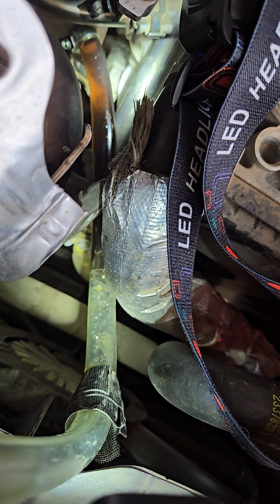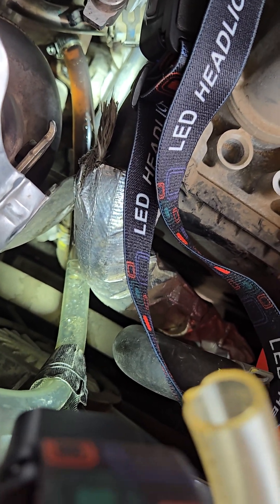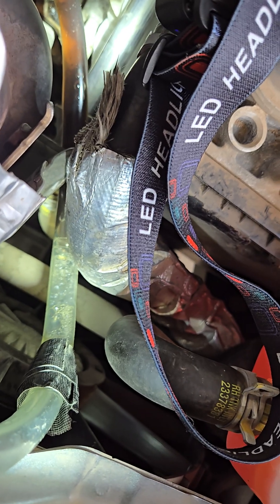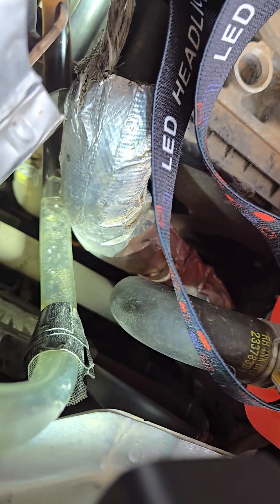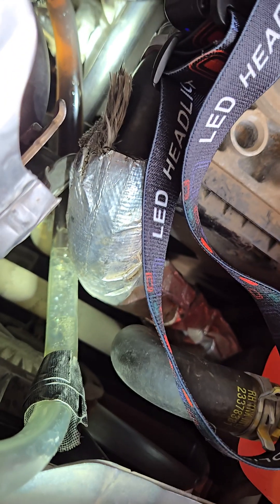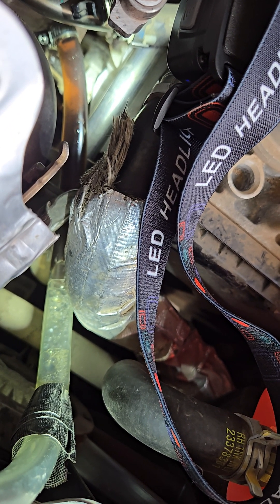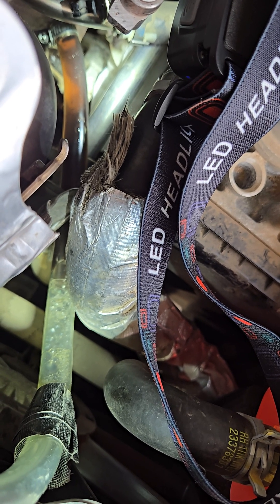Other things not mentioned: it takes about eight to ten ounces or so to get it up to that level. Another critical thing is that you do not want that purple power to come up too high. That whole bottom area — as it starts to come up it's pretty flat. You do not want it coming up all the way, because it'll go into the back of the engine where the exhaust cooler sits on top of the valves, and you're going to have a hard engine start.